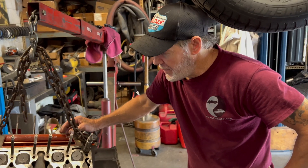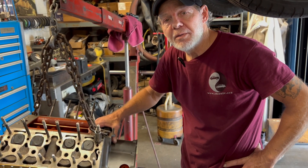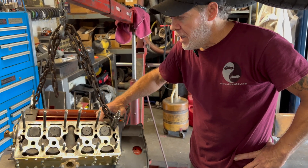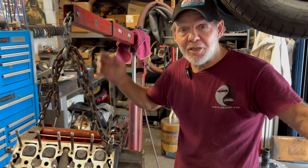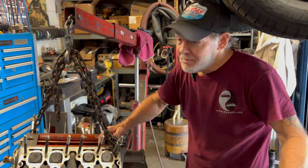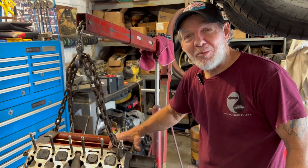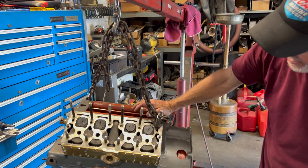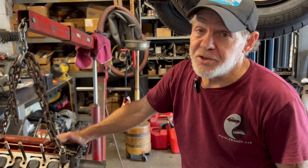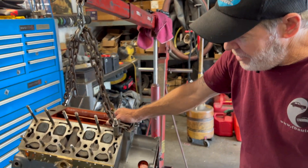This is a race car that ran at Le Mans, so having a V8 makes sense. Why would they want a four-cylinder option? It's for fuel saving. Even in a race car, on Le Mans' big track, if you can save a gallon a lap that adds up quite a bit. Also, fuel quality back then wasn't very good either, so as far as the car lasting — and if you could pick one side or the other, maybe if you had a problem on one bank, say you dropped a valve or broke a valve spring, you could still run on one side.